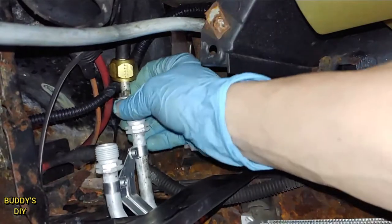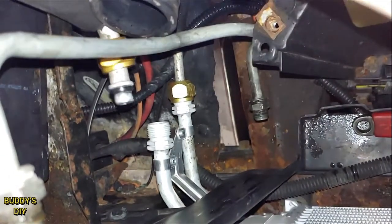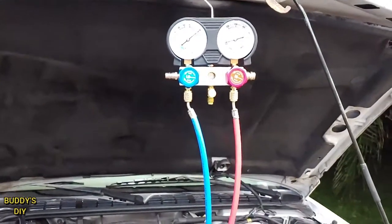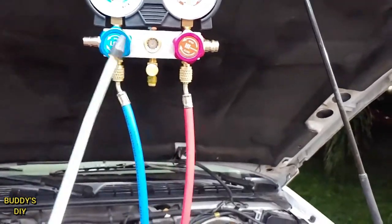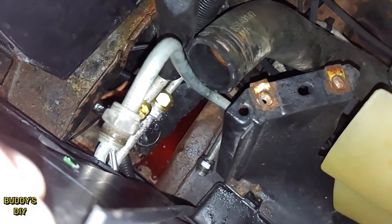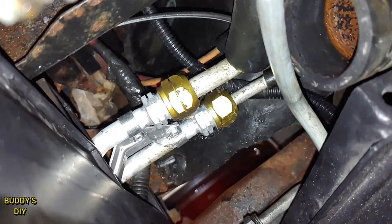Before I secure the condenser, I'm going to plug in my high pressure line because this is the hardest one to get to. Then we move on to the low pressure line. Once your condenser is properly seated, start by screwing in the brackets. I hooked my manifold gauges up to the system, sprayed air in with a rubber tip using an air compressor, then sealed the system to check for leaks. I sprayed it with some soapy water and found the leak right here in this fitting — you can see it blowing bubbles. Tighten up those fittings and we'll get right back to the video.